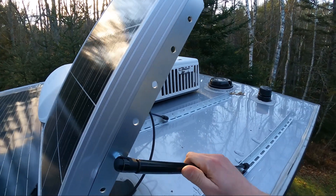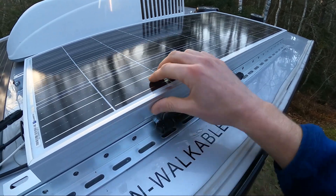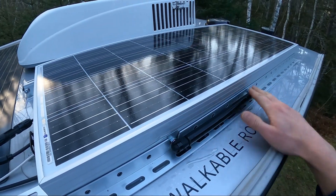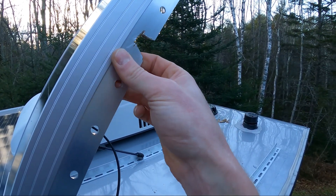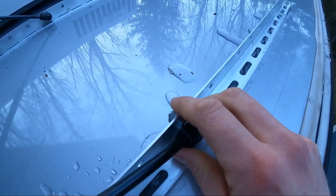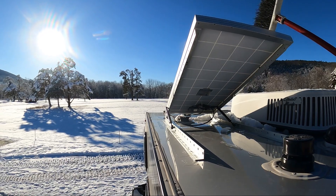When you push it down, it compresses. And the cool thing is when it's down, it's down — it's actually pretty hard to get it extended on the highway, so the forces just aren't there. When compressed, all that force is lateral, not vertical. I'll lift it back up so you can see the other part I had to do, which is right here — I did have to grind it. I used a Dremel to carve out an opening because the securing bolt on the back has to pass through. That lets me put it up and take it down pretty easily.